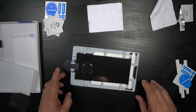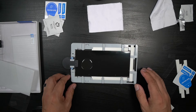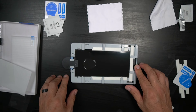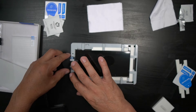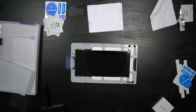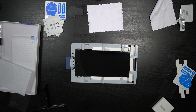That looks pretty good. The next step is to push down on your guide so the glue bubble moves to the middle, then let go of the pin. Push it all the way down to the middle and let the glue cover the entire device — let it dissipate and spread until the whole screen is completely covered. It takes about 30 to 45 seconds to spread across the entire screen.